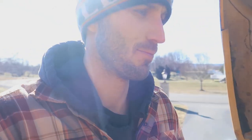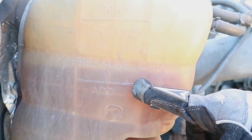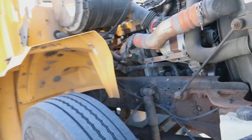That is very exposed. Last time we took out the heater on the inside and needed to top off the coolant. When we got to the bus it was right at the add line. Now since we've moved it, it's gone up a little bit, but I'm gonna need to refill some of that, and you can see underneath the bus that it's still coming out a little bit. So it does seem that we have a little bit of a leak.